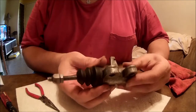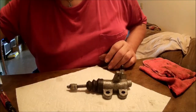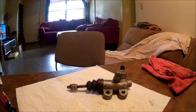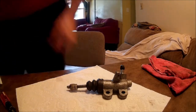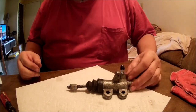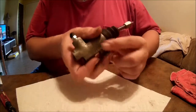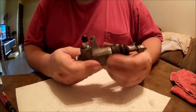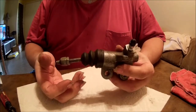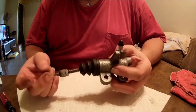That's it, it's done — ready to go back on the truck. Rebuilding these is not hard, just a lot of little bits and pieces of information. Once this gets back on the truck, we're going to bleed the fluid and get the air out of the system. With hydraulic clutches there are particular things you need to do to make sure you get all the air out, otherwise you'll have a spongy or weak clutch and nobody wants that. Hope this helps somebody — thanks for watching and we'll see you on the next one.